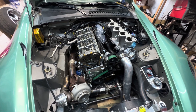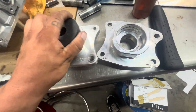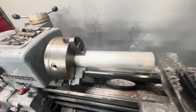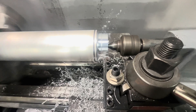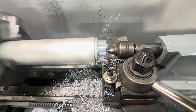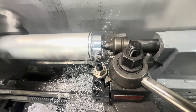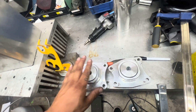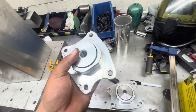These are the normal inserts that go into these diff mounts — two of them blew out. Can't get them from Hasport because of the five to six week wait. So we go to A-Star Fab, buy a big piece of stock, and we're going to make solid mounts. We just got done making our mounts. We were going to do the flange like the other bushings, but instead I decided on this approach because it was a lot less time consuming.